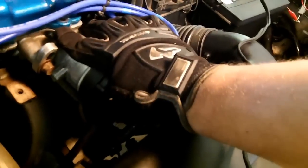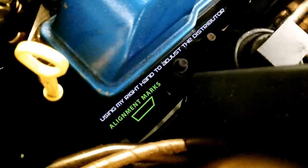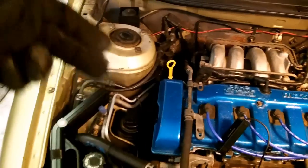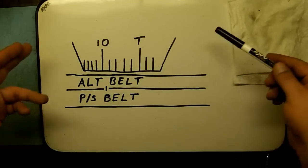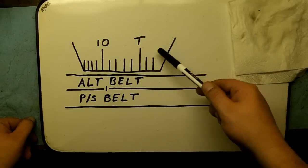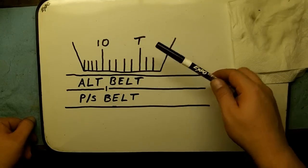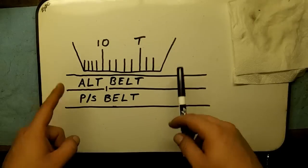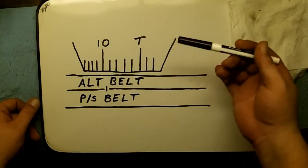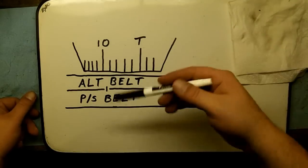Now I have the distributor loosened so I can advance it. You've got the timing light and the little mark and you just have to line it up with the timing cover. Here's a basic diagram showing the timing setup. This part is on your timing cover — it is molded plastic. Your timing marks are part of your timing cover. My timing covers were warped, which is a common problem on the 626. If your timing covers are warped, this might not provide an accurate reading, especially if those bolts have shifted. That's one of the reasons I did the whole water pump and timing belt — just to put on new timing covers.